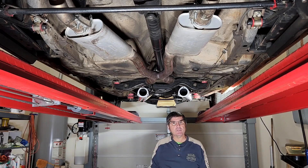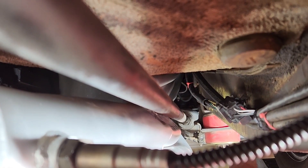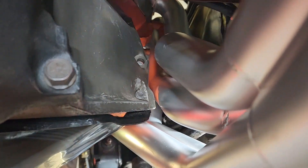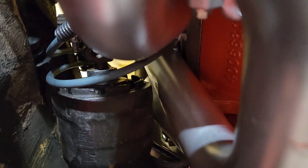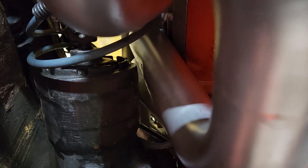I'll try to show you those areas a little closer. I had to open that gap up a little bit, pounded on that tube just a little, and the same thing right up in there. Right up in here is where the tube was touching the trans — opened that up a little bit, and the same thing up there at the steering box. You can see where I had to open that up a little bit. Other than that, the headers went right in.